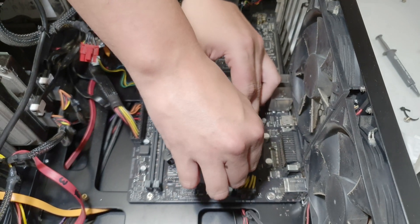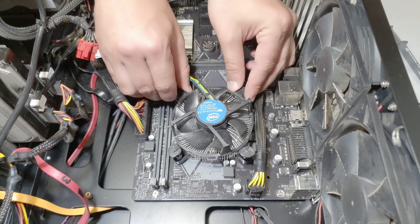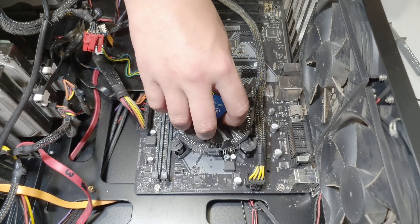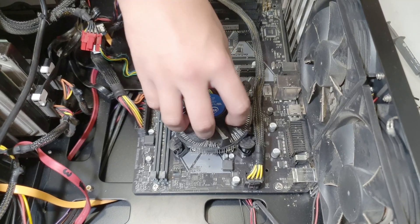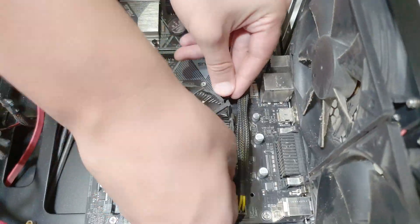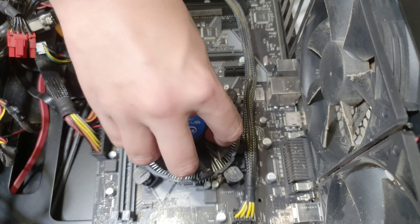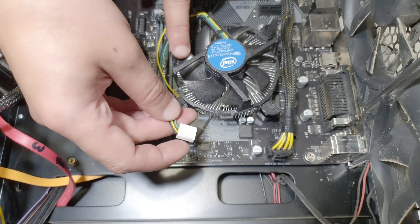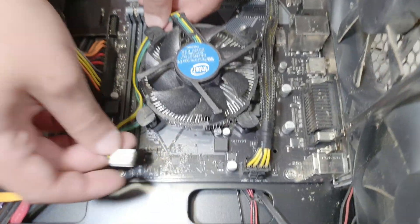Turn that the other way and you should hear a clicking sound to know it's locked. Normally if I pull this now it won't come off. Okay, this one came off — now it's in. Make sure the cable doesn't interfere with the fan, because it'll wear the motor out a lot faster or make the fan stop working, and then your CPU will just die.